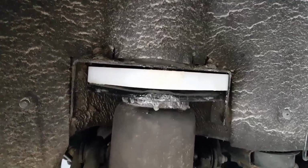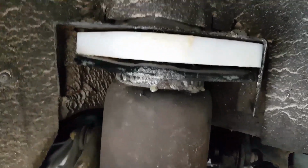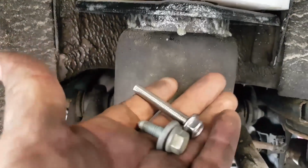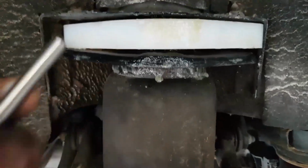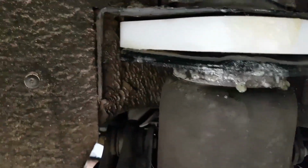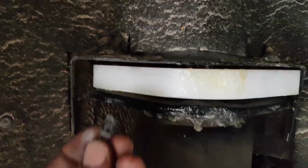So now we've installed the spacer here in place, and released the ratchet straps. The control arm and whatnot are still all loose under there, but just to show here, we've got some M8 by 1.25 bolts that are 25mm longer than the stock ones, in stainless steel, and these flange bolts will go in here. One thing to note: I removed a couple of locating pins that were on the stock flange here.